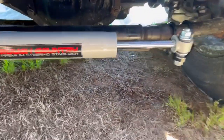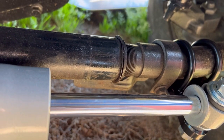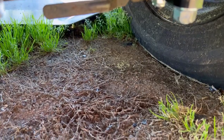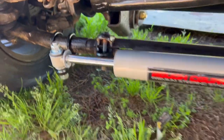I do still have to put a locking nut on that side right there on the cross tube. I can see there's a nut there to keep it from turning, so I need to get one clamp to go there and one locking nut on that side — that side is missing the locking nut. That has to be done before I start driving it.